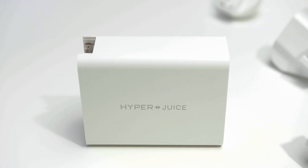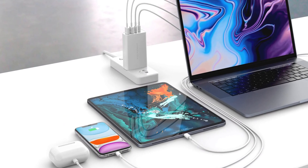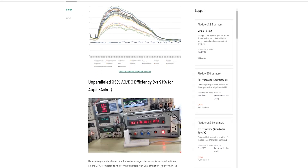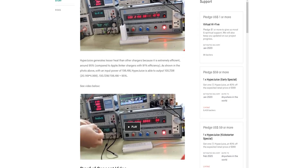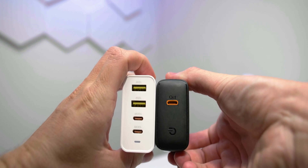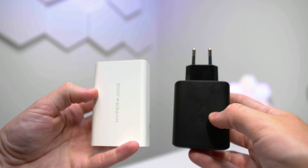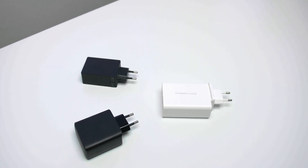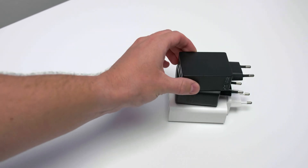Let's get started on why this is so special and why I'm doing a review about it. The most interesting part is that it's a GaN charger. GaN stands for gallium nitride, and this is a completely new way of building chargers. It's made of gallium nitride as a semiconductor, whereas most normal chargers out there are made with silicon. With gallium nitride, we get half the size compared to a silicon charger — it's way more efficient, it runs cooler, and you have more flexibility, meaning smaller chargers with more power and more efficient output.